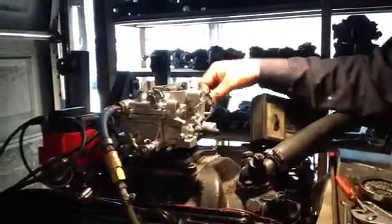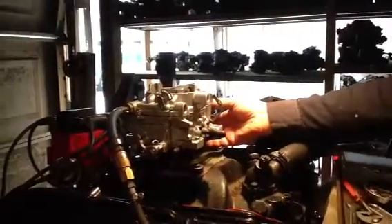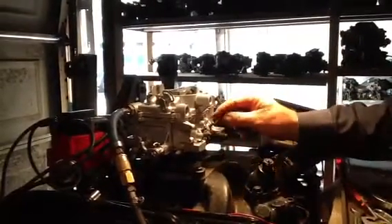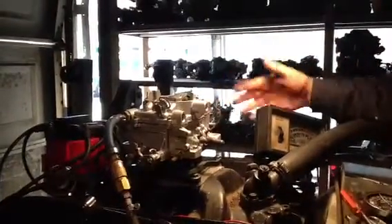Let's start it up. Check our power valves right here — they're popping just fine. We've already set our mixtures right here by turning these in and out so we get our maximum RPM. And we have our RPM here like we always set them, about 800.